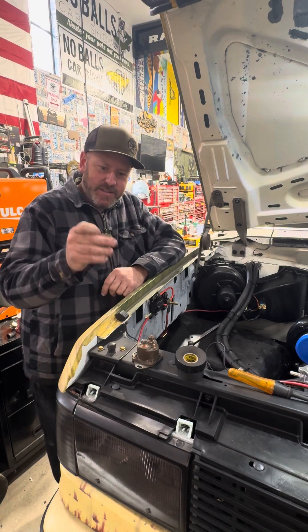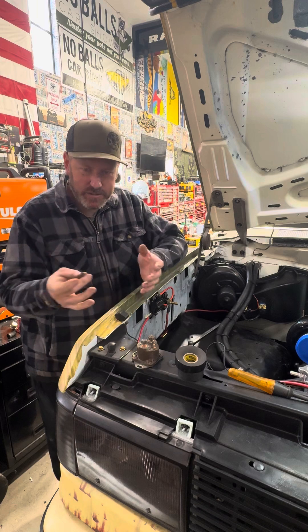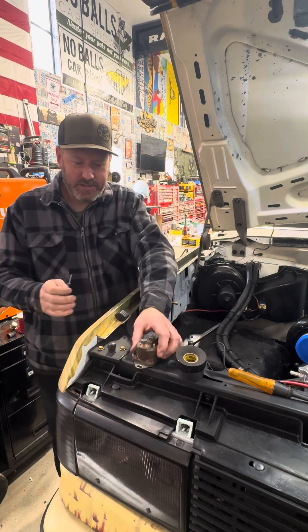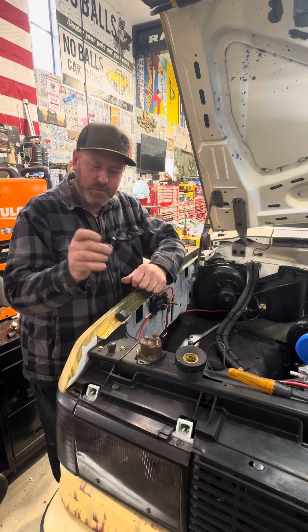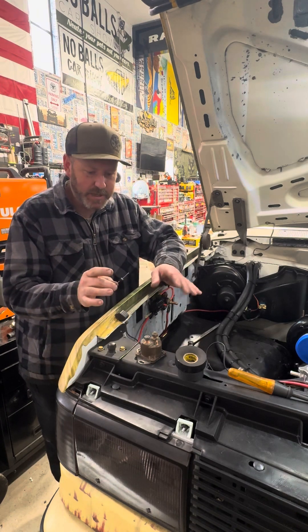This is a lot simpler to put in than wiring up an additional relay with the four wires that would be required, which would be the physical disconnect from the circuit. So this is going to work. If you were to apply more than 15 amps — which I won't be in my scenario — all I'm doing is tripping a relay, which is milliamps.